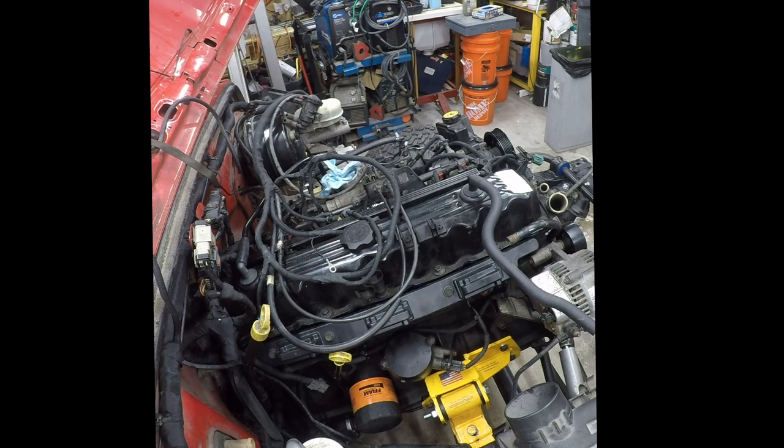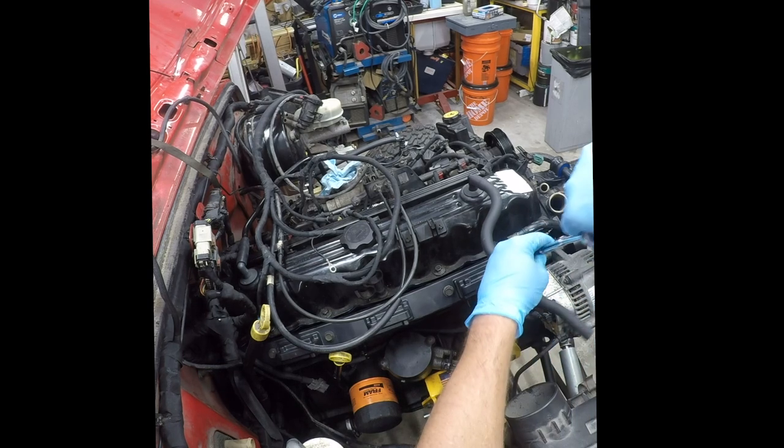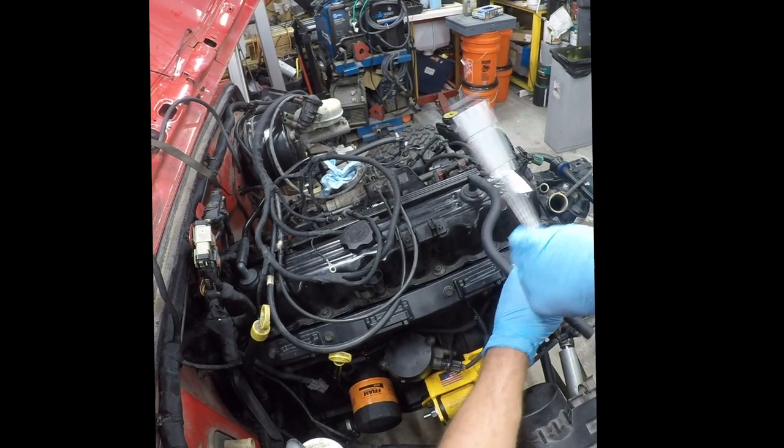Now, one of my aggravations is 250 inch pounds is all the way up on this torque wrench. So we're going to start with 80 inch pounds, and we're going to bring them all to 80 inch pounds. It says to tighten them in stages. I think I'm going to need some extensions on this. I normally prefer not to use extensions on torque wrenches, but I need the clearance and I want them all to be done the same.